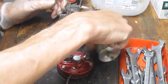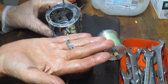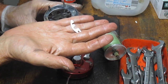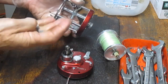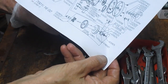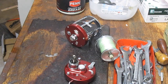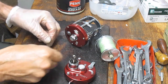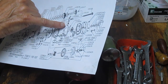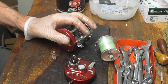On the back of this one, I have a piece here which is usually a lockdown piece. We're going to go to the schematic to try and find out where that piece belongs, because that's probably what is causing the issue. That piece is loose and it shouldn't be. There's a lockdown piece on the inside frame that's come loose, and we're going to have to go reset that. Looking at this, I'm guessing that's the problem. We determined from the schematic that it belongs inside the frame with a little clip and guide — we can't get at it this way.